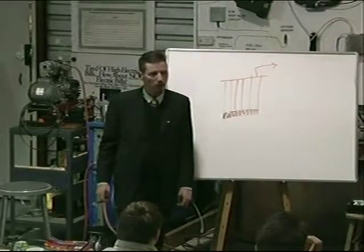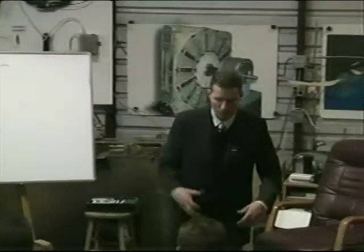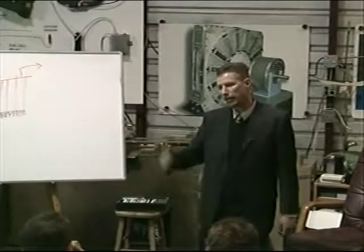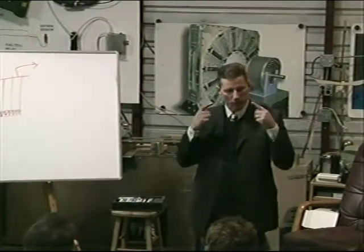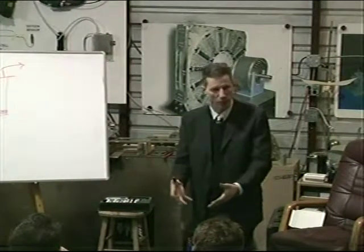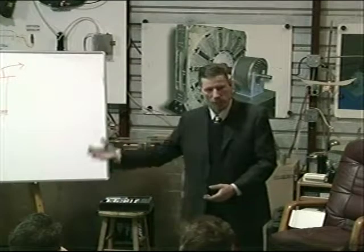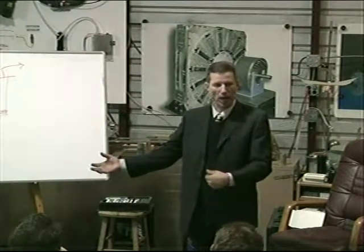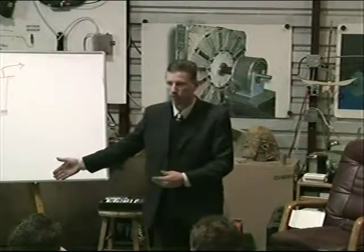If they do have a buildup, how do you get it out for them? Okay, let's assume that you're drawing 55 amps, blowing fuses left and right, not getting any output. Physically remove the unit, wearing gloves, eye protection, skin protection, because this is a caustic material. Potassium hydroxide is just as harmful to our neutral pH bodies as hydrochloric acid is. It's just on the other end of the spectrum.